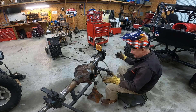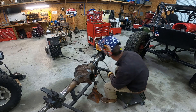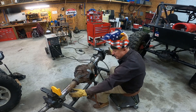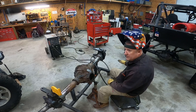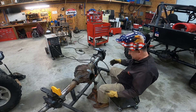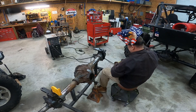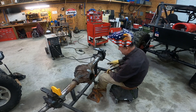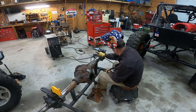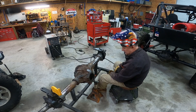Alright guys, we've got our axle situated. I've got 21 degrees here and zero degrees here. I have measured the width — it's 59 inches here, 59 inches on the front axle, so we should be the same. I heated this up but I've been on the phone with people so it's probably ice cold now. But I'm going to go ahead and start tacking this on, then I'll spin the alignment bar to make sure we're straight, and I'll just do a few stitches, little tacks around the side. Hopefully, fingers crossed, this thing will end up okay.